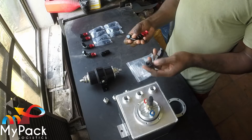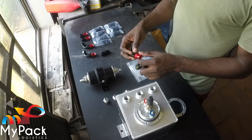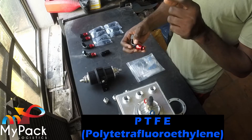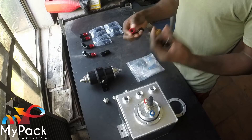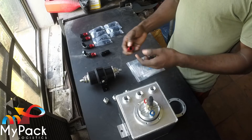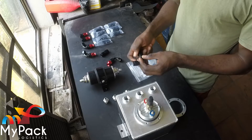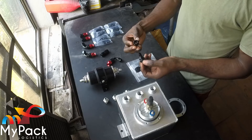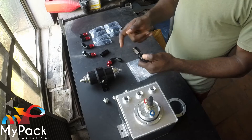I had bought the wrong fittings — I think the term is PTFE. You have different braided lines: some with rubber and some with a Teflon lining on the inside. The one with rubber — this fitting you simply screw it off, push it over the hose, push this down, it tightens, and you lock up and you're good to go.